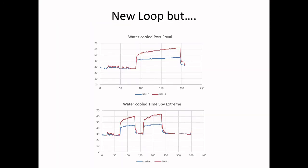But I still had the problem. After I repasted it, I started looking at the thermal properties — how hot the GPUs were getting. After repasting, one of the GPUs looked to be pretty cool, under 50°C, which I thought was pretty good. The other one was up in the sixties. At this point I had no idea if this was good or bad. I didn't really find anything that told me what temperature range a water-cooled GPU should be in.